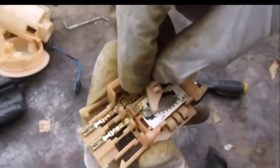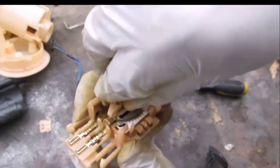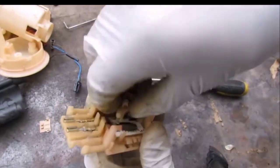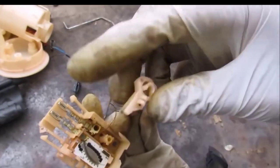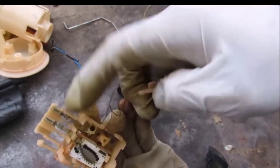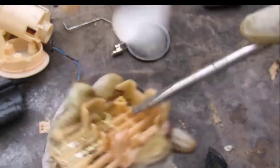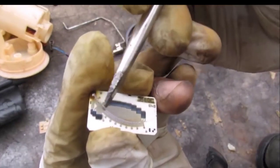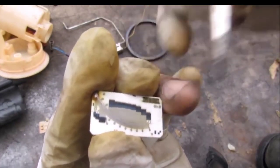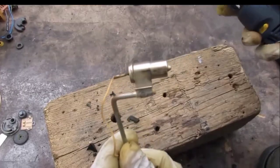The resistance is picked up by the second pin. To remove the arm, I'm going to turn it all the way to the full position and then pick it off with the board — it's got a little spring on the inside. You can see where the arm connects to the ground connection. Now I'll remove the circuit board, which is just a piece of ceramic with printed resistors on it that add up as a series circuit as the level moves toward the empty position.